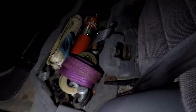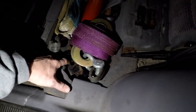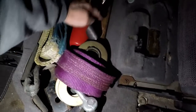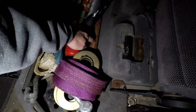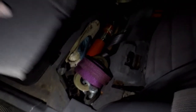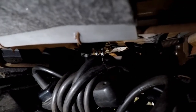Underneath this seat I've got a snatch block for the winch with a tree saver and a clevis. Here is my little cheap tow hook that goes in the receiver. Another tree saver. Here is a hickory handle — like a hammer handle — if you have to hook a couple of tow straps together instead of using the clevis, you can loop one through and stick that in, so if anything shears it'll go flying as opposed to sending a clevis into your windshield or your face. Got some bungees in there, and another fire extinguisher. In the front there's a CB that we use when we're wheeling out on the trails. Underneath I have my winch controller and another tow strap just because.